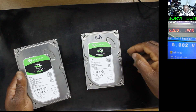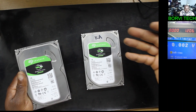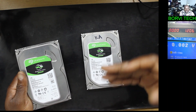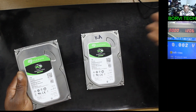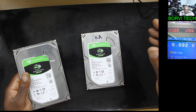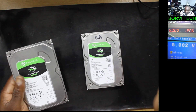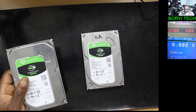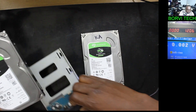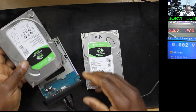If you do that, the hard drive will power on but you won't have the data — it will not read the data — unless you swap the firmware. But before then, let's test something. He came with his hard drive reader, okay, let's see together.